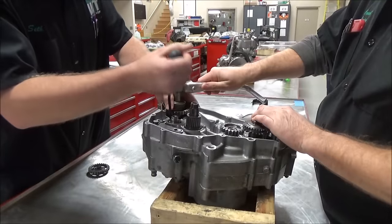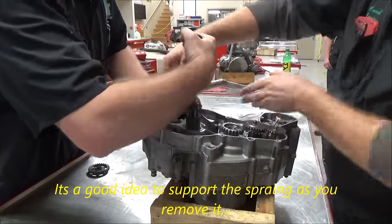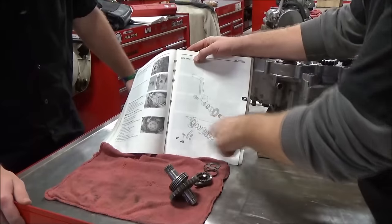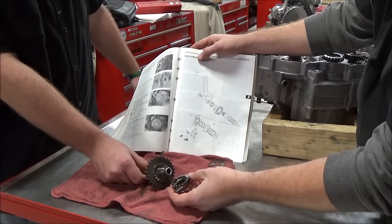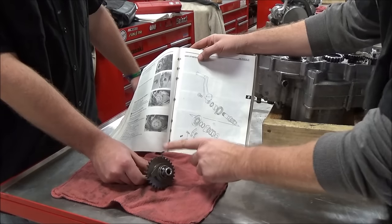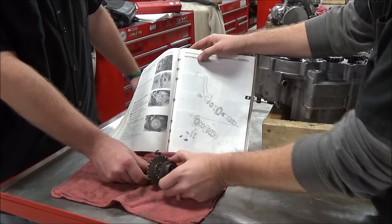Your goal is to try and just lift up and have it where it doesn't go flying. Go ahead and have this laid out in the correct orientation so that we can put these back in the right order. When we kick the Kickstarter, this springs up and then engages in here. You're going to see in a second when we test that to make sure it's working — you see how it just locks in there.